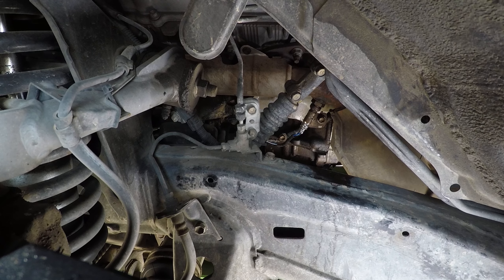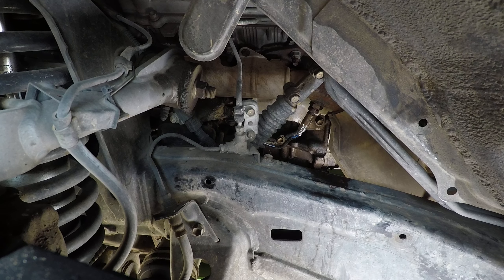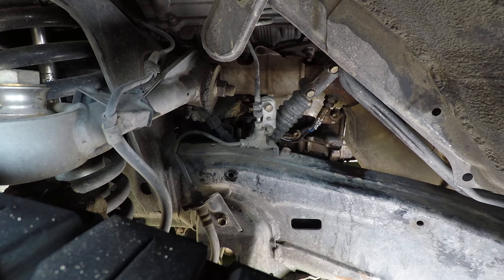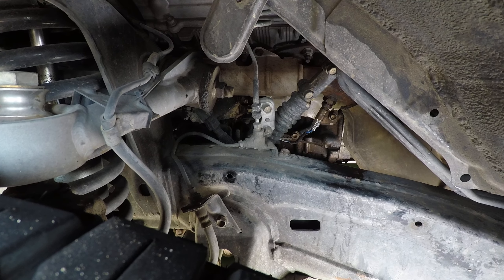You sometimes have to get under the car and reach into the oxygen sensor area to loosen it, and then you can take it off by hand. This is a 2003 GX 470. Unfortunately it didn't solve my problems — I think my catalytic converters are gone and will need replacement. But I just wanted to show how easy it was. These are the upstream oxygen sensors; I had previously replaced the downstream ones, which are more accessible from the bottom.